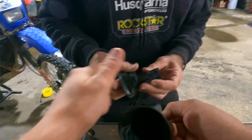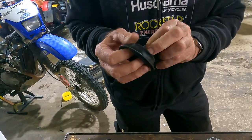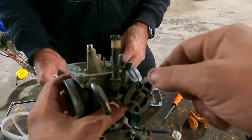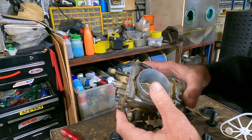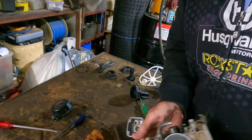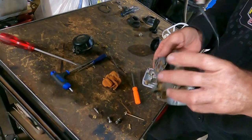I was thinking to use this slide in my diaphragm — yeah I can just swap them out. They stretch pretty good, they don't break easy. I've cleaned this up good, taking all the screws out. See, there's an air corrector jet in there too that you can actually pull out and make sure there's nothing wrong there, but the thing's been running okay. Was there a spring on here? Yeah it's in there. There's actually a little washer in there too — you go to blow that and they fly out.